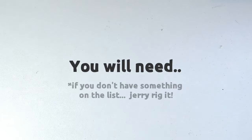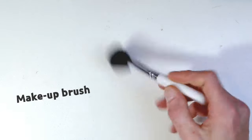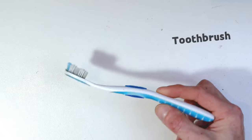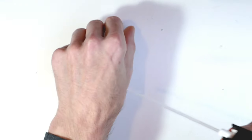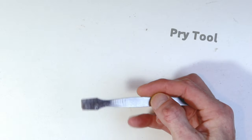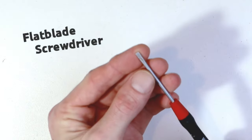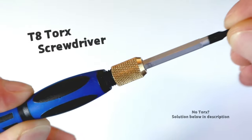You're going to need a makeup brush or something similar — these things are optional. You've got a household brush and a toothbrush. We've got the air duster can — they're pretty expensive, about $25 a pop, so you can buy one of these rocket ship blower tools off Amazon that's a bit cheaper. We've got a pry tool as well. All this stuff is listed in the description with links. We've also got a flat blade screwdriver and a T8 Torx screwdriver, which is the one that's actually going to open the screws.